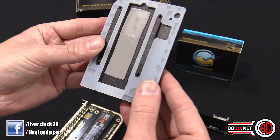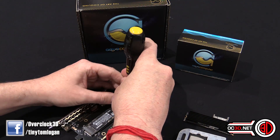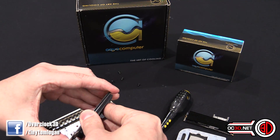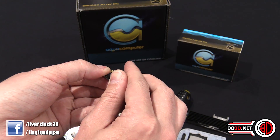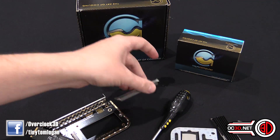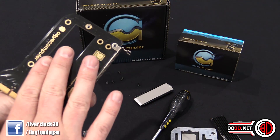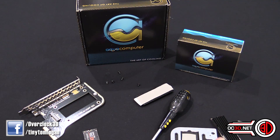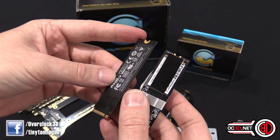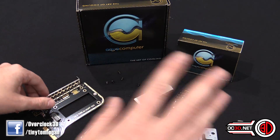There are thermal pads on this. This is the bit that lights up, and you've got a thermal pad there to help transfer heat into the main bulk of the heat sink. I'm going to take the drive out totally to show you, because there is a secondary heat sink as well - which is basically a carbon copy, very similar to the first small one that we looked at held on with clamps. So you get contact with the heat sink from the big section on the front, but it also has a secondary section covering the back. I wanted to compare these two drives because they are very different - the Corsair has two chips on the back, but on the back of the Samsung there are none.